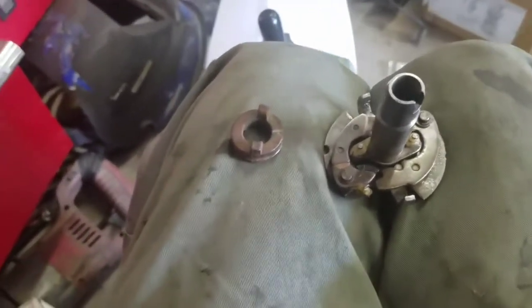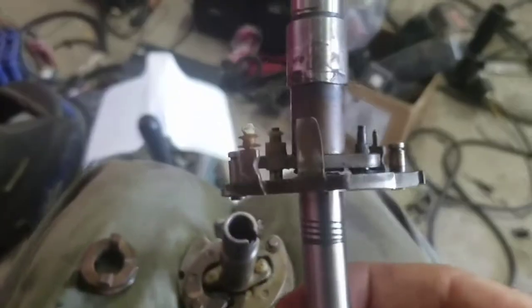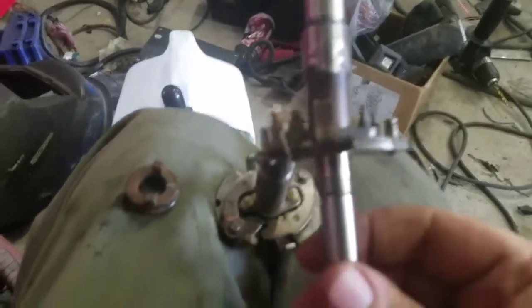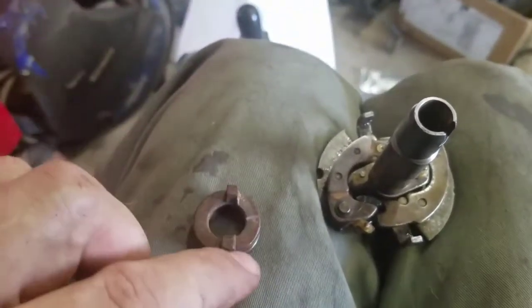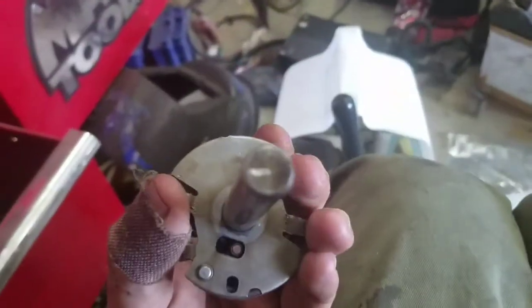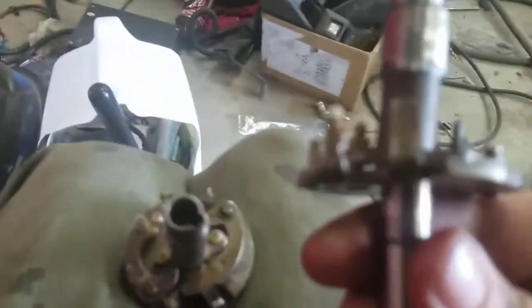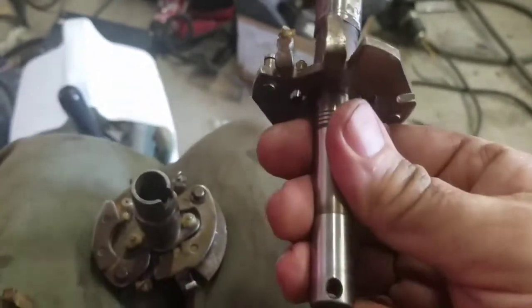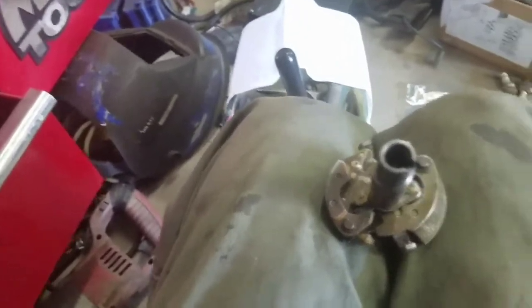Before going further — I've already modified it but I forgot one key crucial step. Luckily when I was trying to take the other one apart I couldn't get it loose and ended up bending and damaging it. The important thing: you can see this part is offset — you need to mark it before you take the whole distributor apart. This could end up on the other side if you don't. I can tell which way it goes back together since I snapped this one.